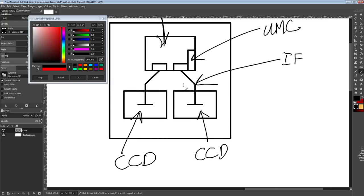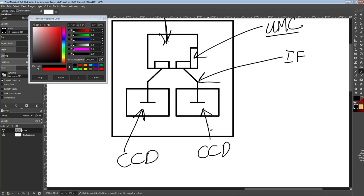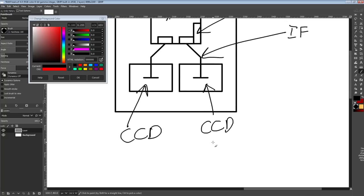You don't really have to be too worried about the memory controller on Ryzen 3rd Gen getting very hot, because the IO die itself just doesn't get very hot. It doesn't pull a ton of power — upper limits of IO die power consumption are around 20 watts, which is nothing compared to what the cores can pull. An 8-core CCD can easily top out in the 100-watt range.